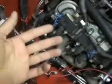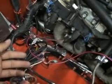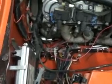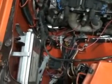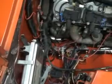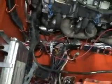You can find all the Datsun wiring. The ignition, ACC, start. For the start, just use the stock wire from the starter. It just hooked up through the solenoid to that little tab. Just hook it up directly to the purple wire. For ignition or ACC, all the wires are cut out, so I just tested them with a multimeter, and whichever one turned on in ACC, I used. But make sure it also has power when it's in start mode, because otherwise it'll just be cranking and cranking, but if the computer's off, your engine's never going to turn on. So, yeah.